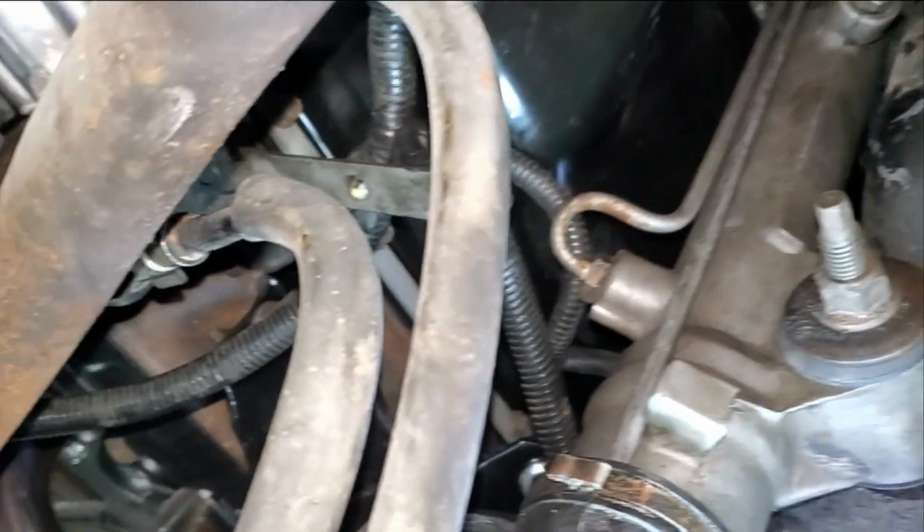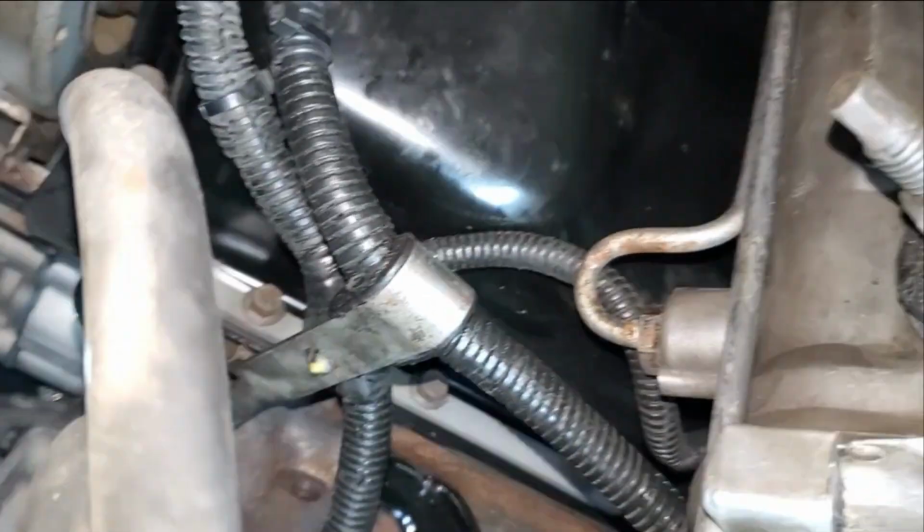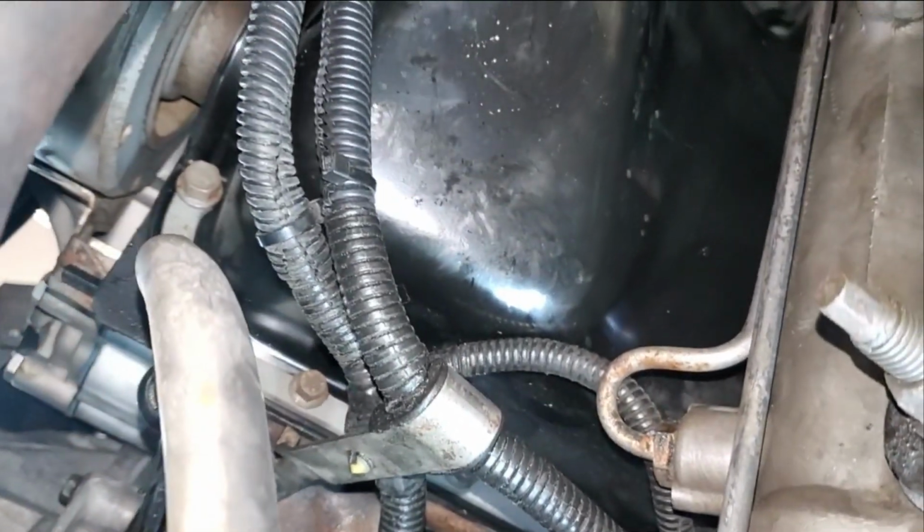One thing I wanted to tell you that I ran into is apparently the newer starters have a little bit longer cable. So last night, I put the starter in Frankie. Starts, you know, it works. But my problem still exists that existed with the last starter. I thought it had a lazy solenoid on the starter and it was keeping it engaged after you start it for, I don't know, 2-3 seconds, and then it releases. New starter's doing the exact same thing. So my thought is maybe there's something wrong with the electronics going to it, keeping that engaged.